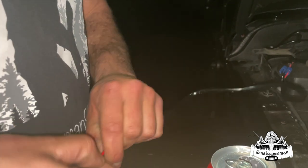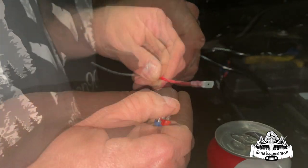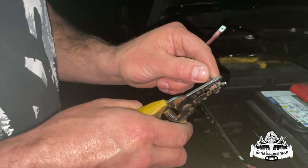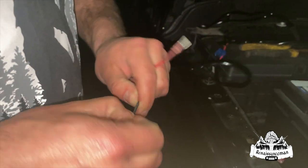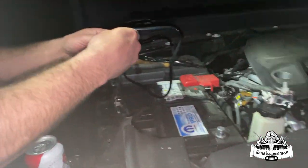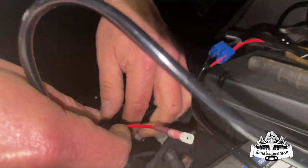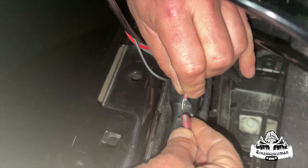So we got our red wire here — we're down to the last two wires. All four pod cube lights are all hooked up. We're just going to strip our red wire here, give it a little twist, and put the male part of our quick connect in. Last wire — our black one. Black is the ground. For the ground, we picked up a heat shrink ring terminal. Here on the Jeep, we have these ground posts, so I'm just going to connect the ground up to that. Nothing's touching the battery at all here, which is really nice — we can hook up other stuff to that too.